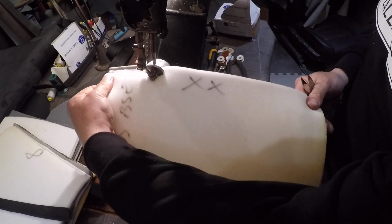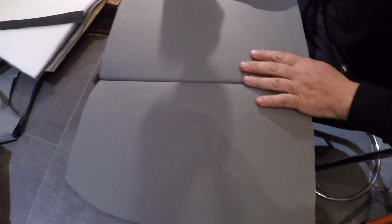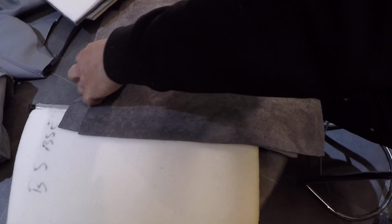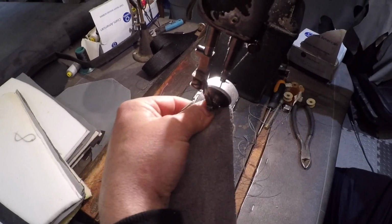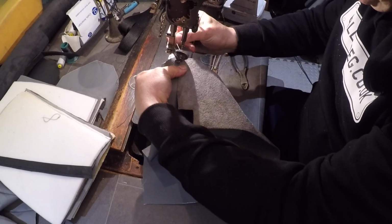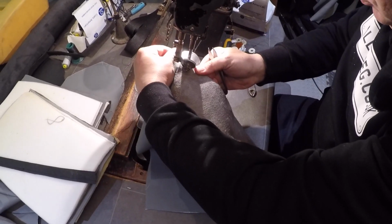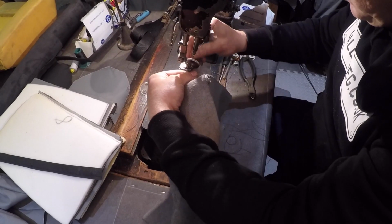Now to assemble the back seat base. This is made up of 3 sections on each side, one rear piece, one centre piece, and at the front the knee support. We connect each piece together and at the same time seam the hollow tape in position that we need to hold a wire in place to help fit in correctly later. Before attaching the knee support piece, you will need to seam together 4 corners so as to fit correctly onto the base seating foam.